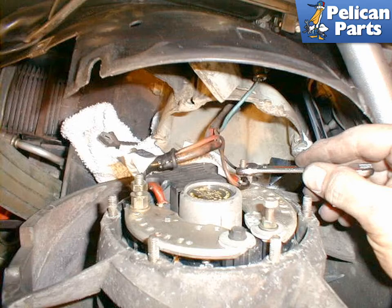You should have already disconnected the battery by now. Once that has been done, carefully label and disconnect the connections to the alternator. Remove the large thick ground strap as well. Be aware that the wires are quite old and subject to heat from the engine, and may be more brittle than you think. Try to avoid moving them around or bending them too much. Inspect the connectors carefully and replace any that look damaged or rusted. Double check the wires upon reinstallation — it is very important not to confuse and mix up the terminals to which the wires are connected.